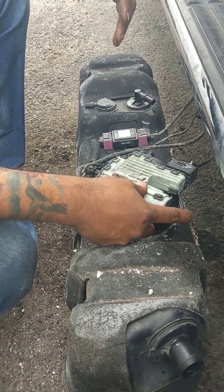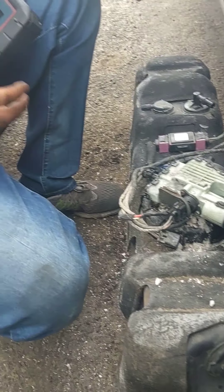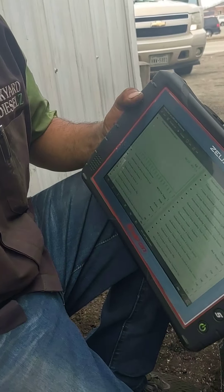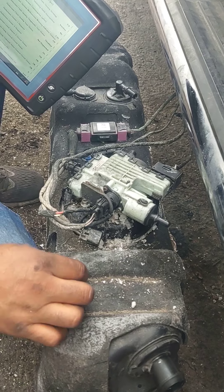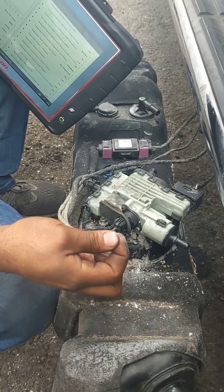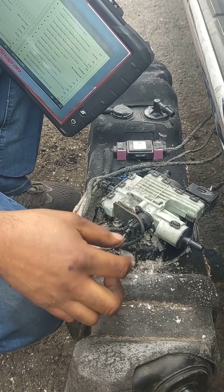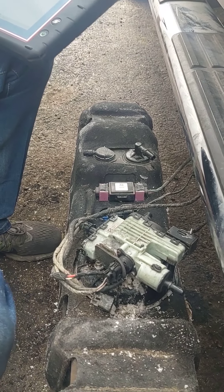That's pretty much it — we got a leak in the system. Your pressure sensor is working good; we just verified there's nothing wrong with it. Visual — we've seen it, it's leaking. That's what happens to the DEF fluid once it gets aired out — it turns into that crap. I think it's ammonia, salt, or something like that.